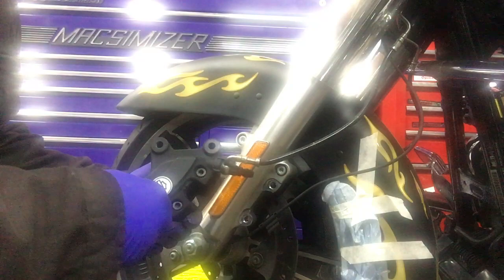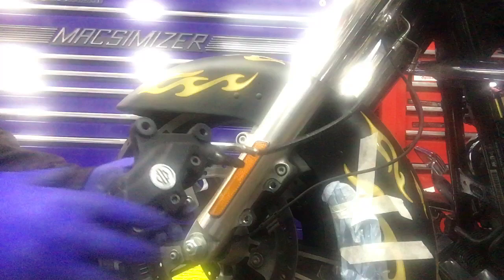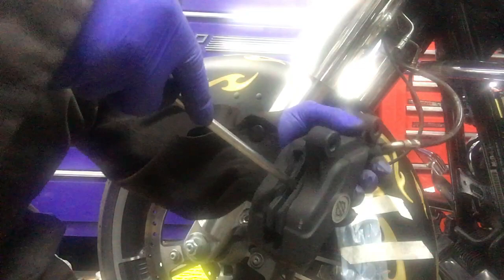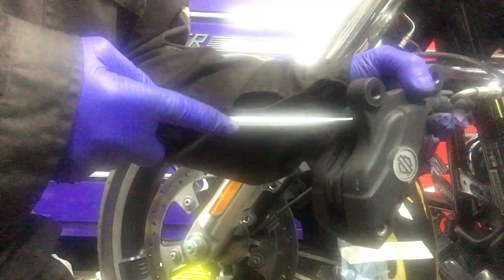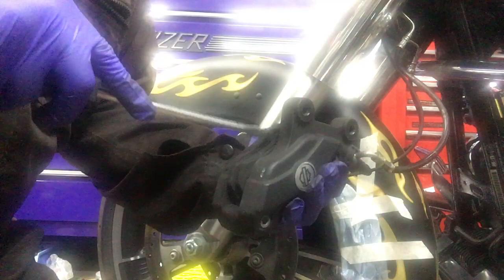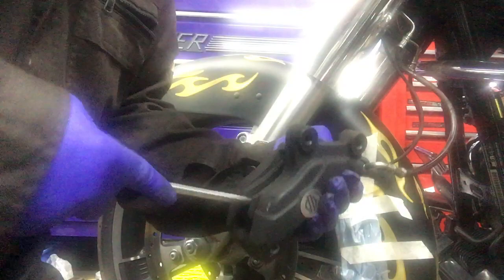Pull on the caliper, push the caliper on the disc, pull the caliper off. Here we've got the caliper. Take this pin out here and basically these pads are knackered. See if they go back in — if they go back in you're okay; if not you obviously need to clean up the pistons. Normally you would use a brake pad pushing tool, which is available, not crazy money from Halfords, eBay, wherever. Or some people just use a G-clamp.